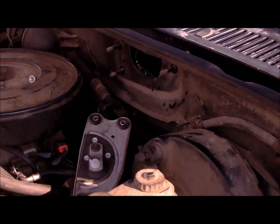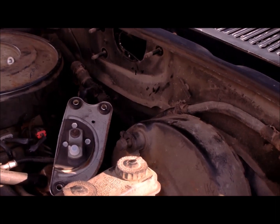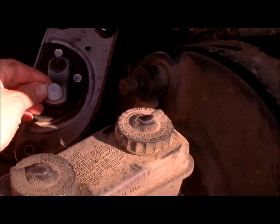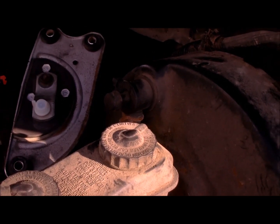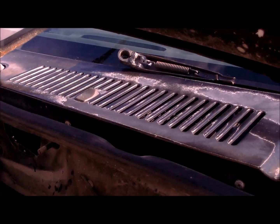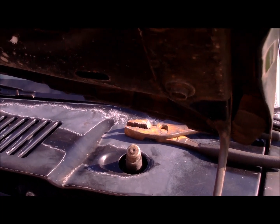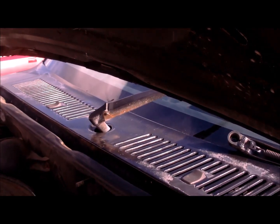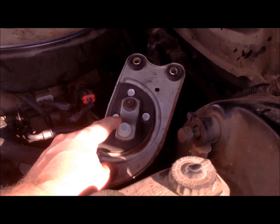I've got my 1995 Dodge Dakota pickup truck — the windshield wipers quit working but the motor still worked. I replaced the connection — these little plastic pieces right here were broken. You have to take apart the rest of this up here, take out the windshield wipers to get in there to fix it. I've taken out one windshield wiper arm and it's a pain — I used pliers and a screwdriver. Now I'm going to work on getting the second one out, then take out these screws to get in there, put the motor back in, connect the piece, and put it all back together.